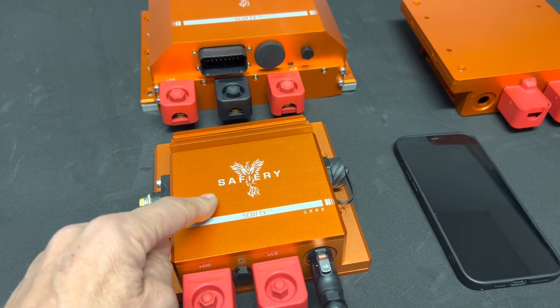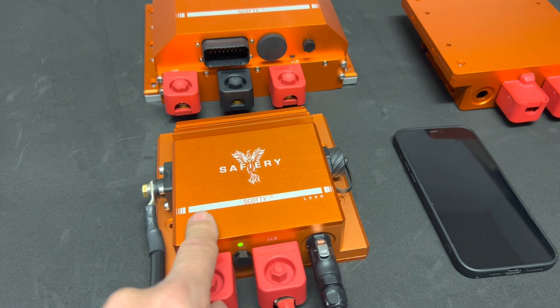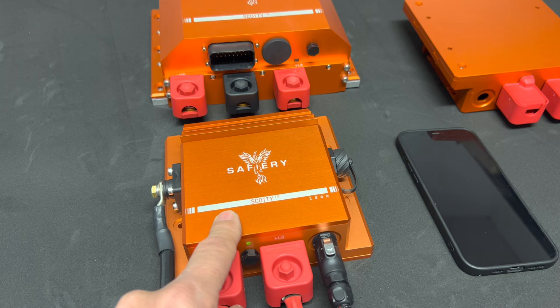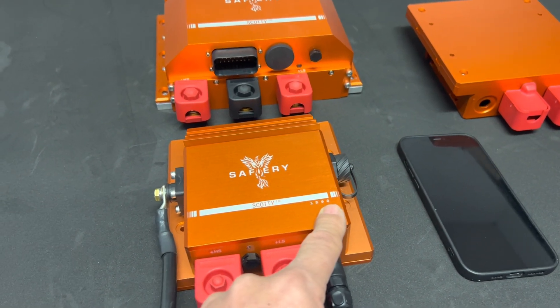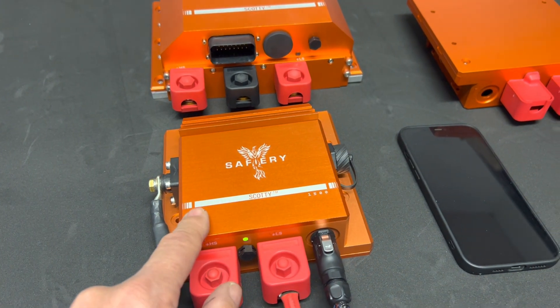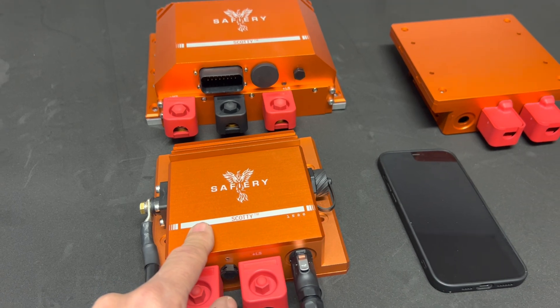In this model we have the much-awaited energy management feature. Linked to our CAN bus trigger — when the engine is below 1000 RPM, it will only go high-side to low-side, so solar will come into the starter battery for better energy performance. Over 1000 RPM, it charges from low to high. That feature is available out of the box. How good is that!